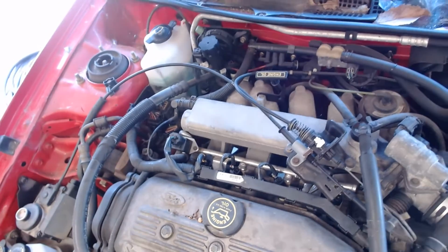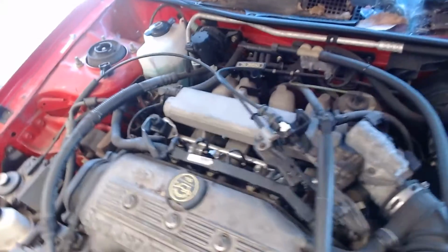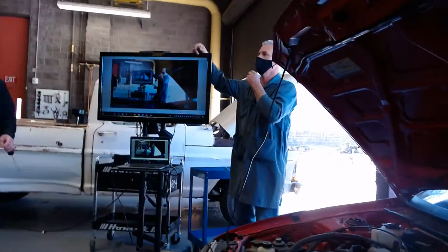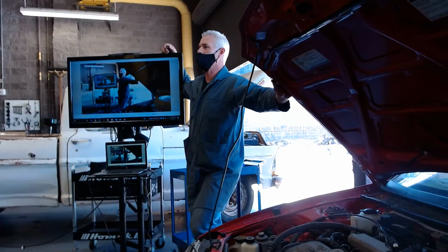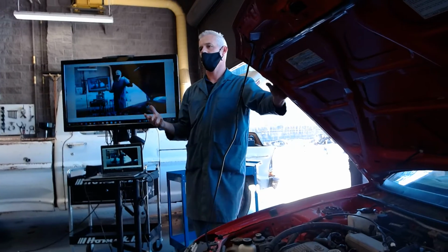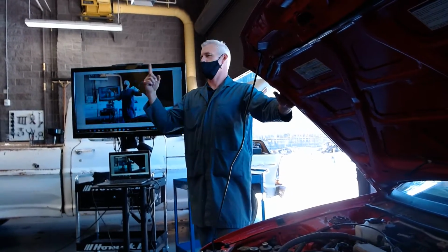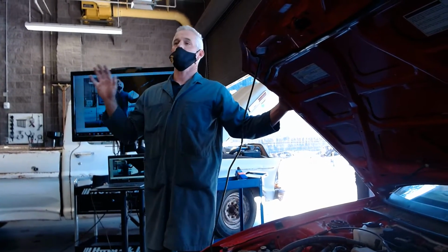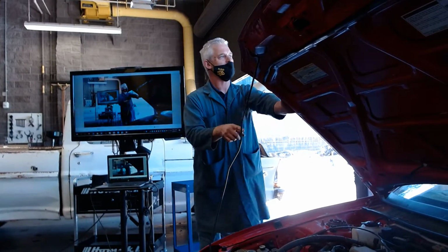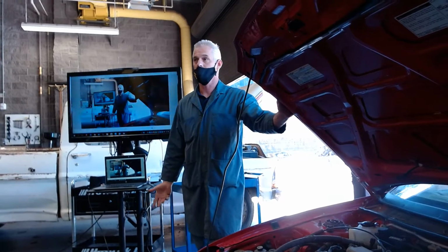Okay, so pause for just a second. Allow me to go back a little bit so I can talk. Mr. O'Connor's car came in the winter, and it's a Subaru. It was running on 3 cylinders, and I got tricked because I listened to the injector. It had a cylinder that was making no power, spark and everything was good. I listened to the injector, and it was ticking like crazy. The injector's running. It wasn't running though.